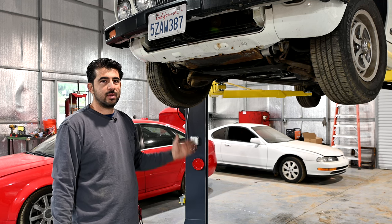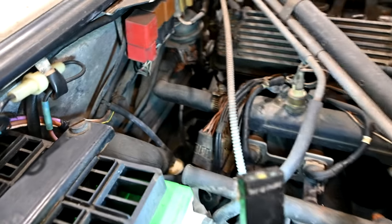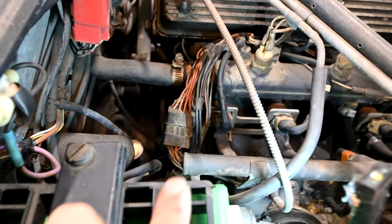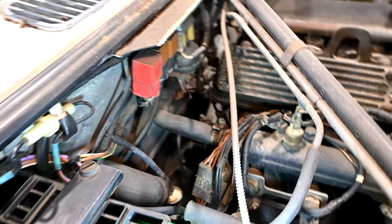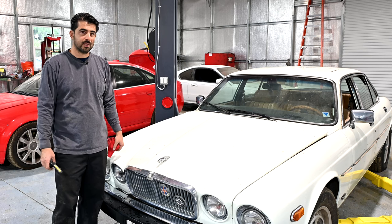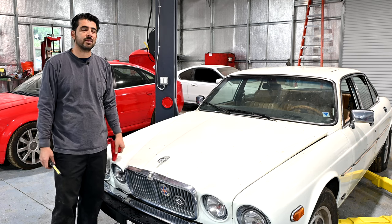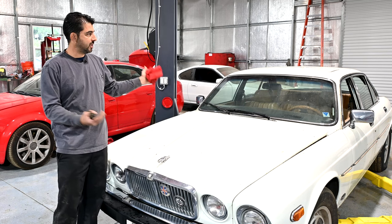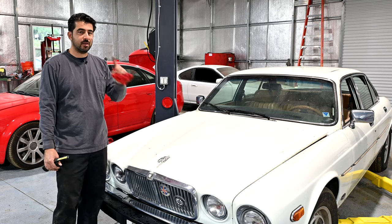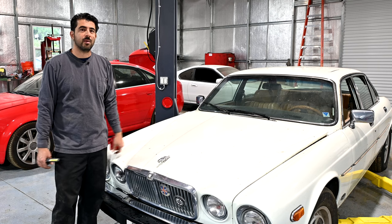So far it doesn't look like we need to do anything too crazy to this car. Let me lower it and show you where the coolant leak is coming from. On the passenger side looking in, the coolant leak is coming from that rusty old clamp holding this hose in — in the same location as those wires. So when we take care of those wires, we'll take care of that coolant leak as well. It looks like we got a decent deal on this car — nothing too crazy needed to get it ready to sell. It does have high miles — 189,000 miles — so I don't know how much we can get for it, but I'm hoping anywhere from five to six thousand dollars, considering how good of a shape the exterior is in. Once this is detailed, the leather seats in the interior are in good condition. Also, the AC on this thing works pretty good as well, so that's a plus and should help get the money we need for this car.